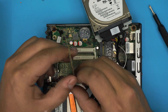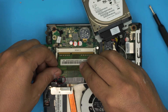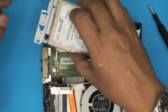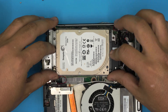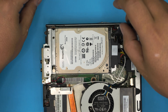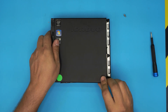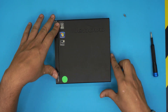If the notch doesn't match, the RAM will not go in — so make sure the notch on the RAM matches the notch on the slot before pushing it in. For reassembly, place the hard drive back in the offset position, slide it back to the correct position, and replace the two screws. Then grab the top cover, place it in the same offset position you removed it from, and slide it backward toward the back end of the PC.